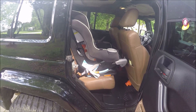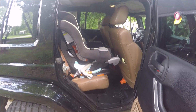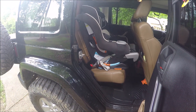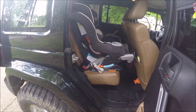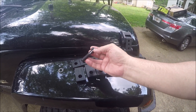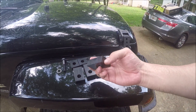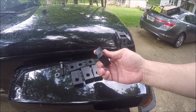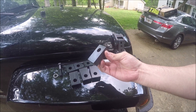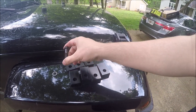Back in the day with TJs, if you wanted seat risers you'd just make them yourself — go to Home Depot and find some spacers and bolts. The kits you'll find on Amazon, and you can find one on my Amazon page, have become much cheaper than what you could piece together yourself. The kit I'm linking to comes with 10.9 metric bolts, which are really strong, and Delrin bushings. They also offer an aluminum version, but that's just to fleece you out of an extra $20 — this Delrin is more than strong enough and structurally sound enough to be a spacer. Remember, all the stress is going to be on the bolt anyway, so as long as you have a strong bolt you are fine.